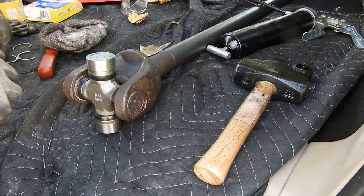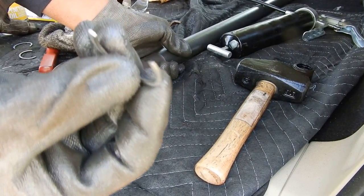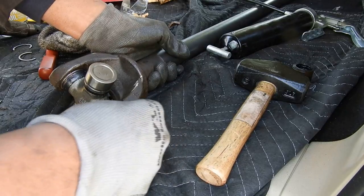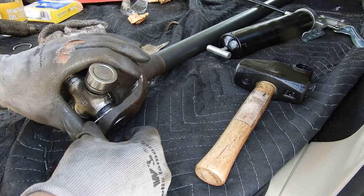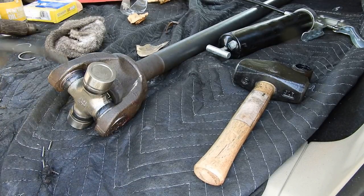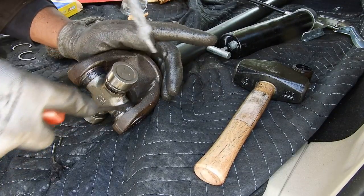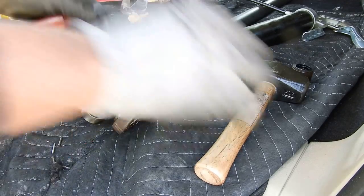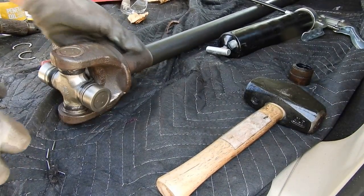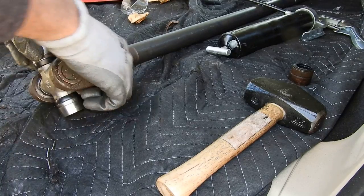Check to see if your snap ring has enough room. A good way to check: grab the tip of the snap ring and place it in there — if it sits in, you'll be able to clear it and seat it all the way. Always make sure your snap ring is seated all the way — this is very important because if not, your u-joint is just going to come out. I push down on it to make sure it's seated. The last thing you want is a bad u-joint coming off. Give it a tap to set it in place.